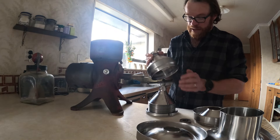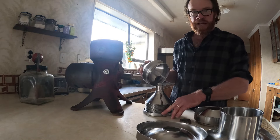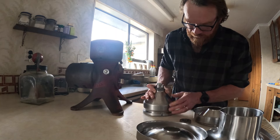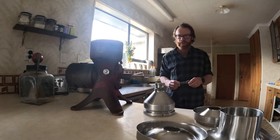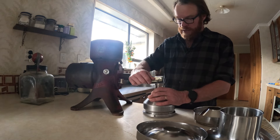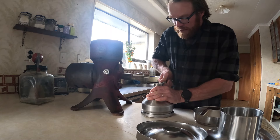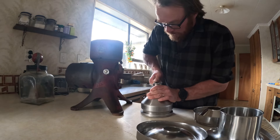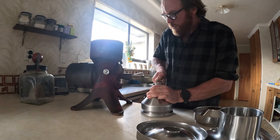Finally, the main cone has a little knob that lines up with a little groove at the bottom. In the bottom of the dish there's an O-ring that it sits on and that will seal it to keep the milk in. That little thing needs to line up as well. A little screw nut goes on top. I have a spanner here — not the original, this is from an angle grinder — and that's just to do this little nut on top up. It needs to be as tight as you can get it so that it doesn't leak. So that's as tight as I can get it.